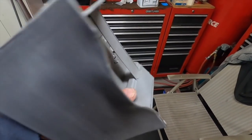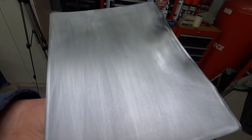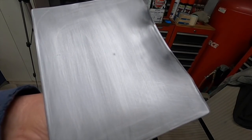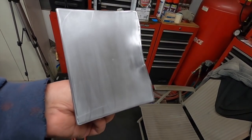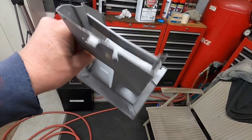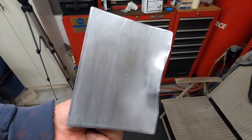Yeah, it cleaned up pretty nice. There's a little nick right there - I think that's not a dent, just a nick. I sanded this with 400-grit and I might sand it a little bit more, but I think I'm going to shoot that with filler primer and then re-sand it with 400 before I paint it. But first I'm going to zinc chromate prime it.